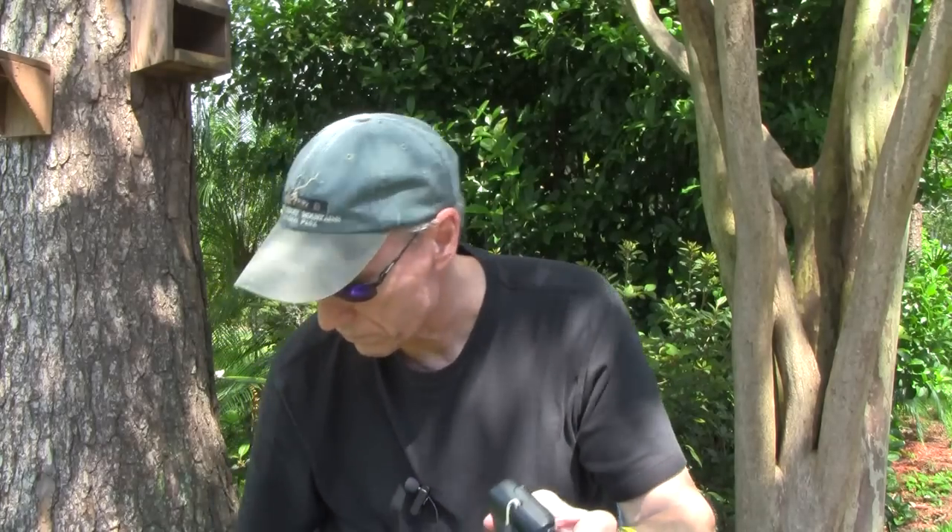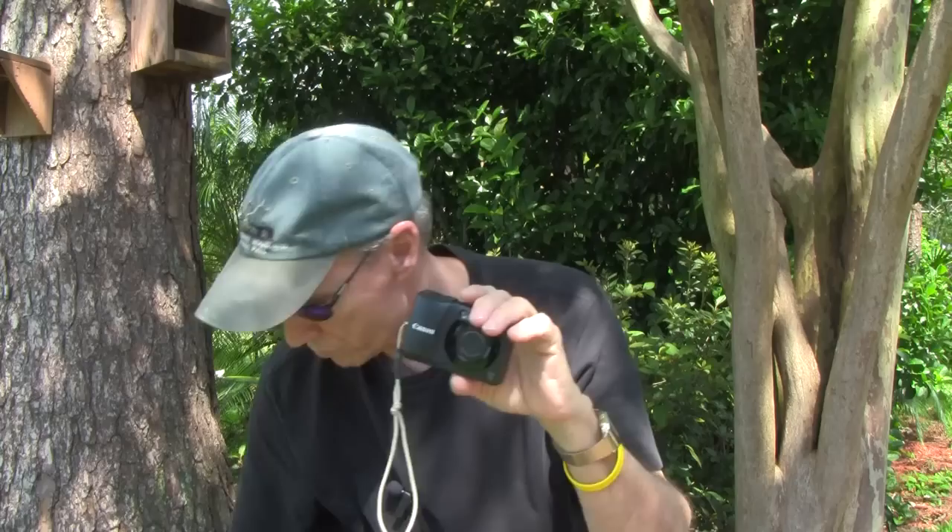The camera pretty well worked, but the control button on top was a little flaky — sometimes it would select the wrong option, sometimes it wasn't working at all. The zoom button worked pretty much except it would zoom out but wouldn't zoom back in. So I took a can of electronics cleaner and sparingly sprayed inside the control button and inside the zoom button, then worked the controls back and forth and used a can of air to dry that out.